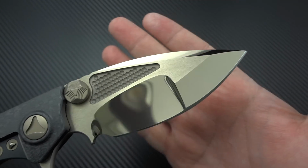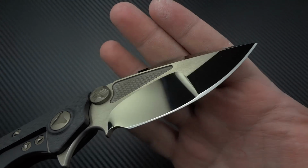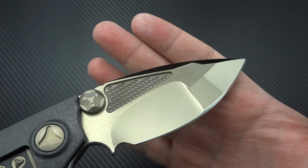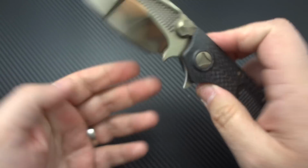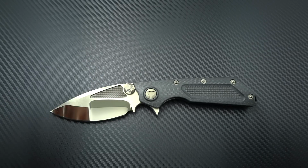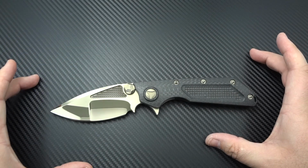And obviously it's working because not only is NASCAR relying on it, pretty much every engine builder is using that technology on their wrist pins and other internal parts, but guys that are building Hayabusa racing engines are also using the Cassidium process as well. So it's obviously a claim that has proven itself to be true. So some of the big benefits is it provides lubricity, so you don't really have to worry about lubricating any parts that are coated in the Cassidium.